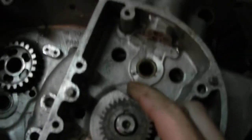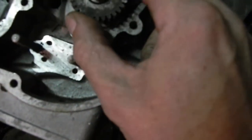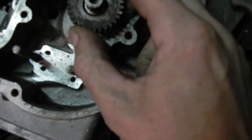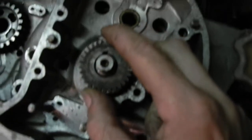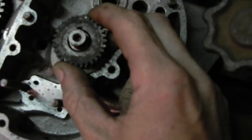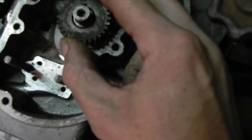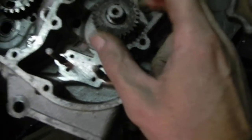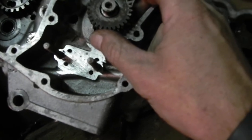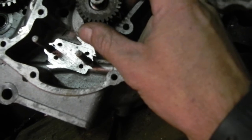Looking at the spare engine, what I think has happened is this has sheared the key somehow — maybe when I started it up originally on the ride to the show, I damaged it because of timing, or just from 18 years of use. I think this has shifted, or the teeth were broken off, maybe one or two of them, and they've shifted over.